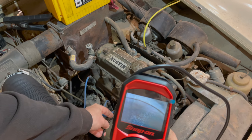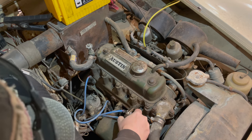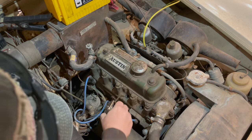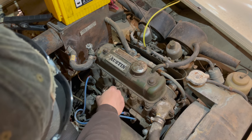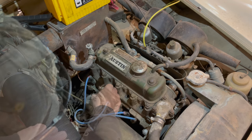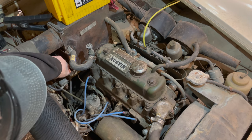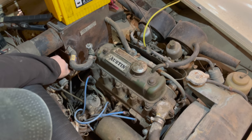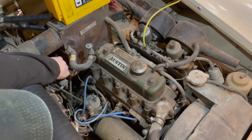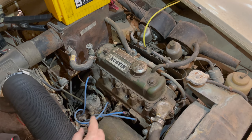I don't see any corrosion in here. I'm going to take my oil can and give the engine a slight amount of oil before I crank it over. Let's pull the starter solenoid and see if the engine turns. It turns over quite nicely. So I think if we have spark, this engine will definitely run.